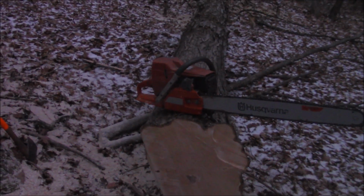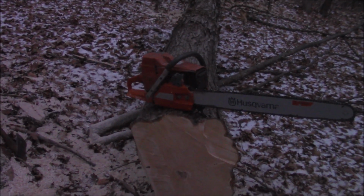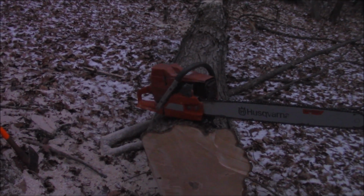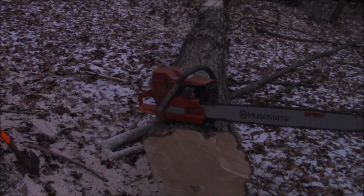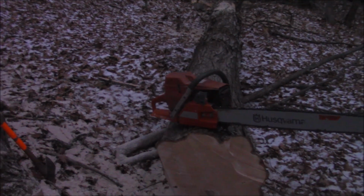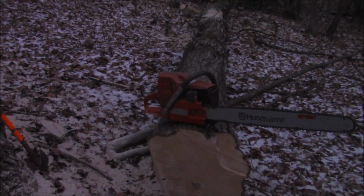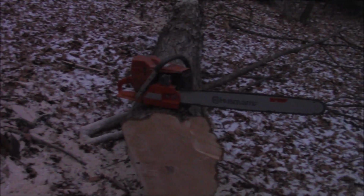So the pluses are it's OEM. A 394 is cool. It has a sticker saying 394, even though it has an aftermarket Hyway big bore top end. It's cool that it's 100 cc's. It's cool that it's a pop-up. It's cool that it has just gobs and gobs of torque and decent RPMs because it's a quad port cylinder design, enough transfer area to actually do that. It's really undercarbureted. That thing really needs a bigger carburetor.